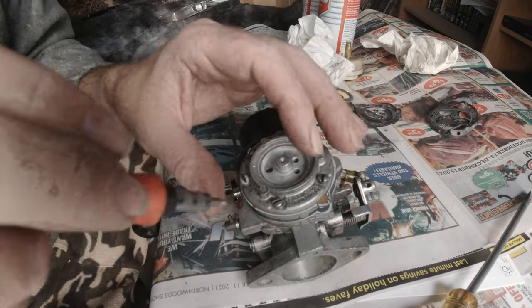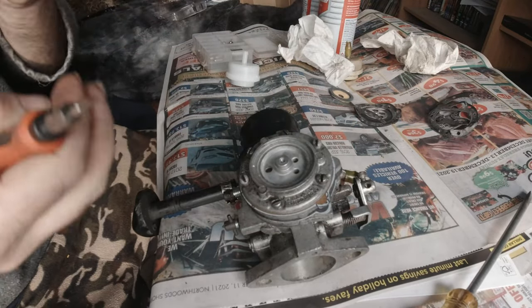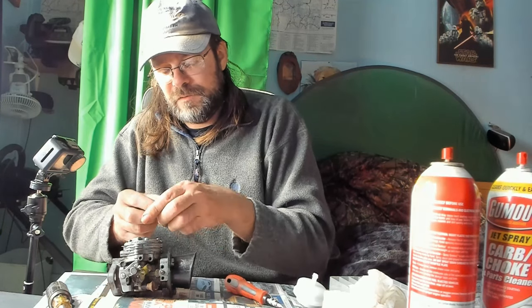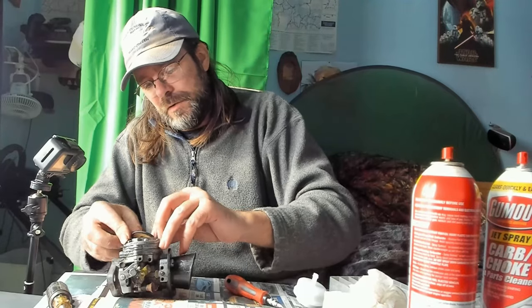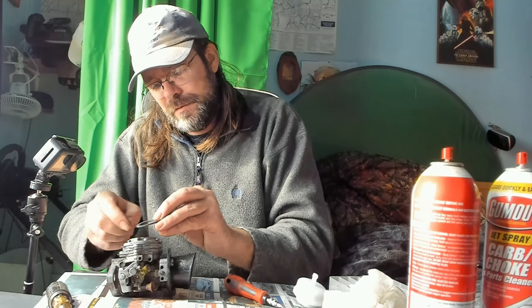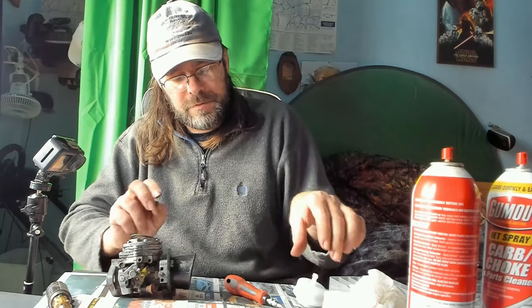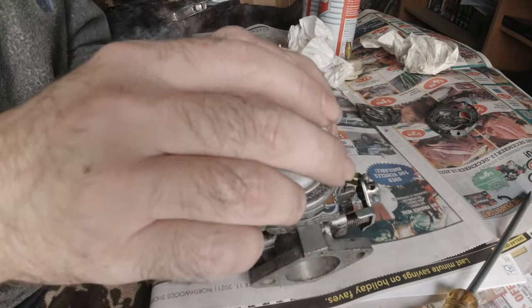We need the suction to be working to pull the fuel. That's how it pulls the fuel up out of the tank. So those gaskets in there work together, sucking the gas. And now we got this little screen, which is kind of an extra, keeping large debris out. And we got this gasket here. It goes in there to keep. Okay. Did I get it upside down or something? I don't think so. Okay, there we go. Yeah, it's good enough. And then we got our new one, which has a rubber gasket in it too, so two rubber gaskets connect together, and that makes a nice tight seal.